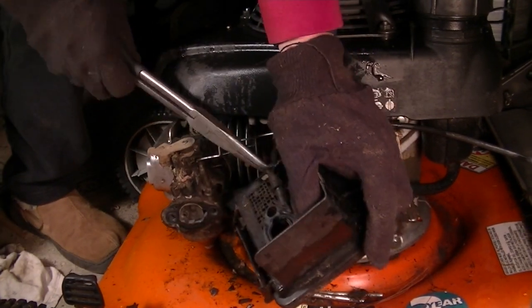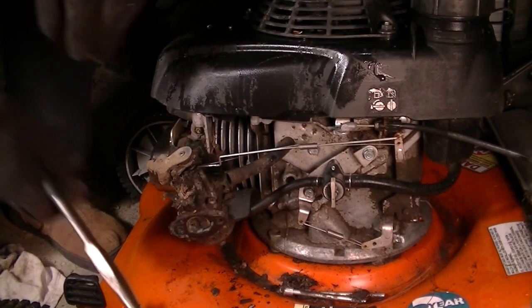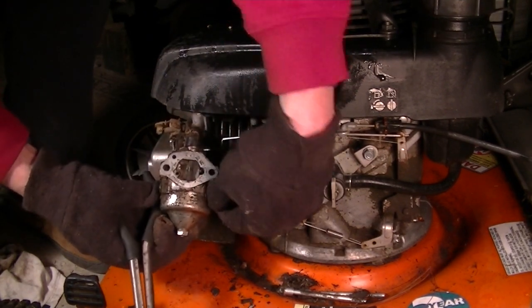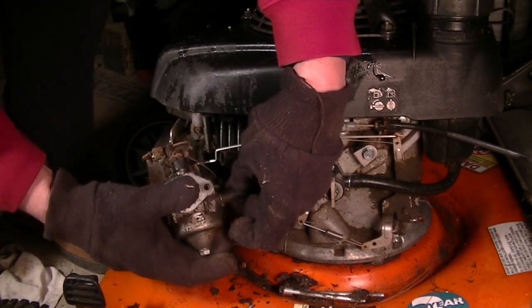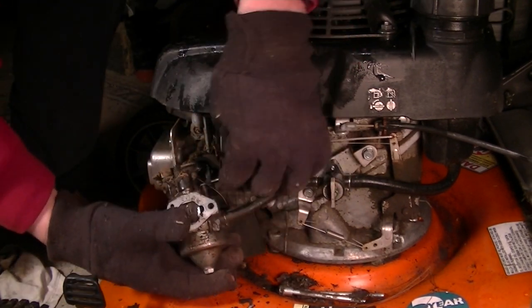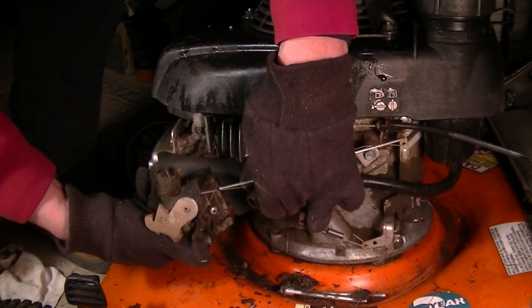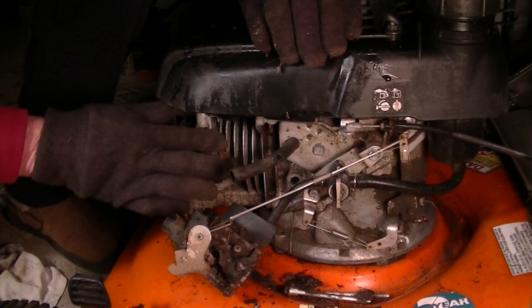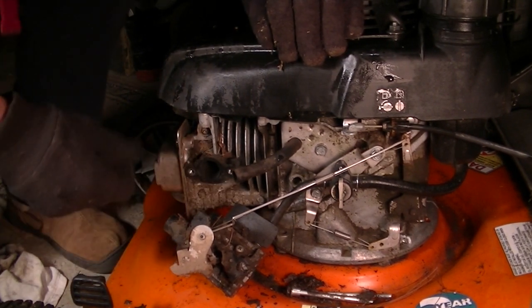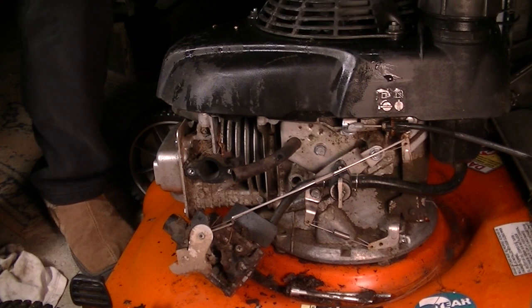You know, I'd much prefer to do this outside. But like I said, it's raining out there. Oh, there goes a gasket. We'll need that. I'll get this gas hose off. A little difficult to see the linkage. This has the automatic choke, and I know those go bad, so. I always try to get ones that I don't have to put any money into because I don't have any money to throw at them. Or it's not, you know, profitable to, when you sell them for cheap.